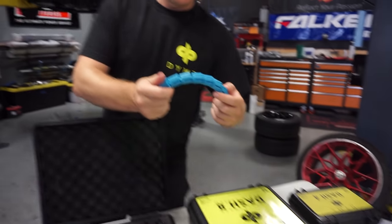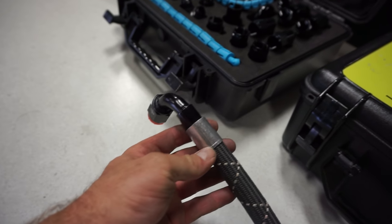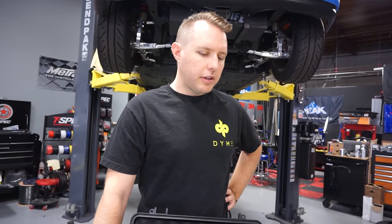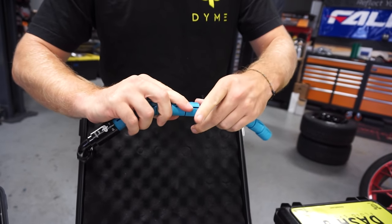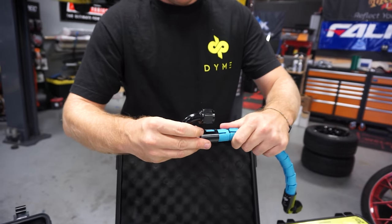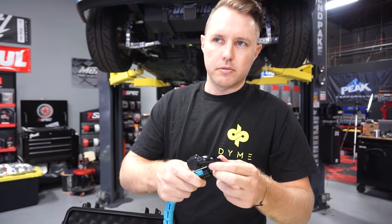Anything beyond that would pop the segment apart — it's probably too tight a radius. I love that they're crimping the fittings rather than screwing them together — it's actually going to be an upgrade for this car. It will last forever and we're not going to have leaking between the hose and fitting. When you put them together, you make sure all the spines are lined up because this represents a certain clocking angle. So this one goes 90 degrees to a 180, and that's pretty much how it works.